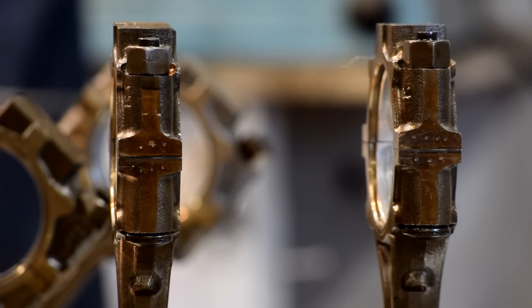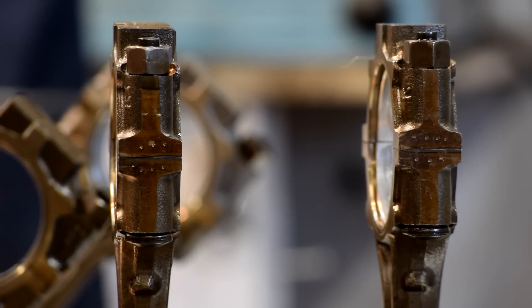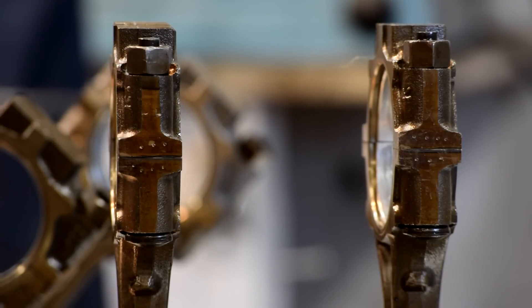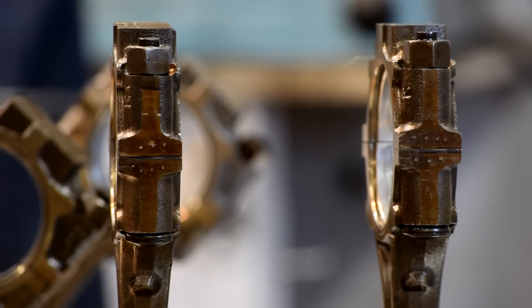Here's one of those occasional surprises you get when you pull the motor out. What we've got here is somebody else's identification marks. You'll see there's dots marked on the rods and the caps — when I had this thing in the motor I punched my own marks on top of the rod pad. So this rod was in position three, this one in position four, and you can see the caps agree with those numbers. But it looks like the rods weren't in the right position — we've got four here and three here, three here and four here. So somebody has had this motor apart before me, and when they did they mixed up the position of the rods and the rod caps. I'm going to have to talk to the machinist and explain that to him and see if it's worthwhile swapping the caps back and rehoning it or vice versa. The other interesting thing is that may explain why one of these pistons looks so much newer — it may have been that the whole rod and piston assembly was changed out.